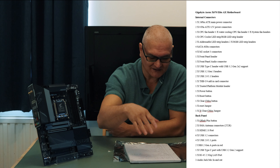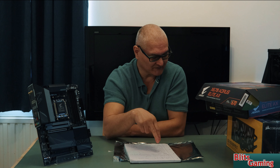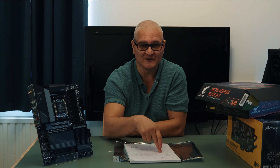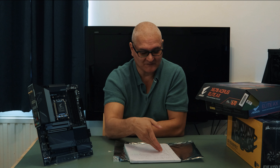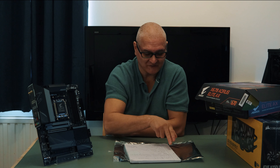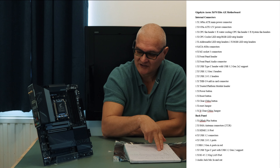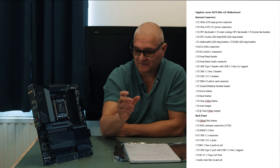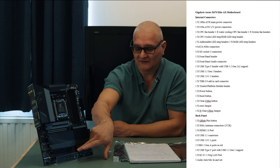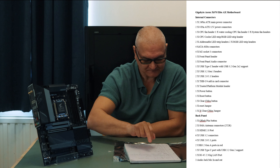If you're using Windows 10 it doesn't matter. From there we have a system fan header, plus two more internal USB 2.0 headers for your chassis — or if you've got one of these Corsair coolers, their power connectors use a USB header. It's worth knowing about the USB headers on your motherboard, as a lot of cheaper boards these days have come down to only one. Next to that we have a USB 3.2 internal header — the big chunky one. The USB 3.2 leads can be very thick and can break your socket, so you've got to be careful.